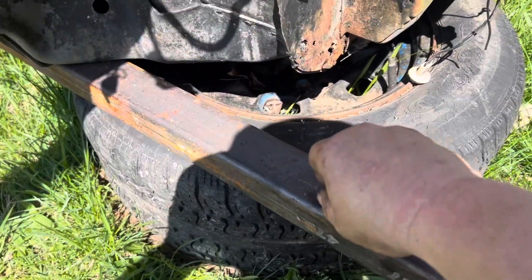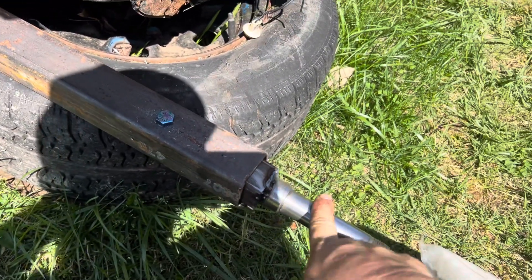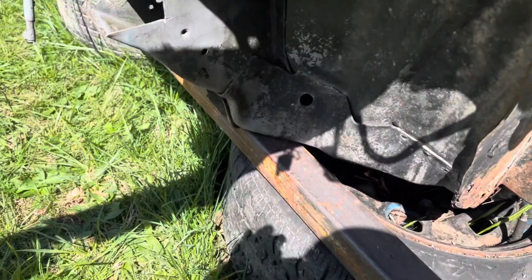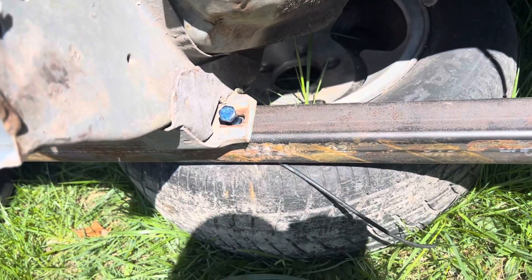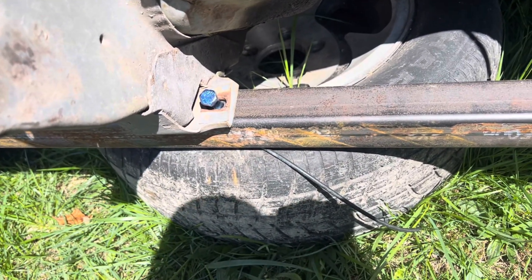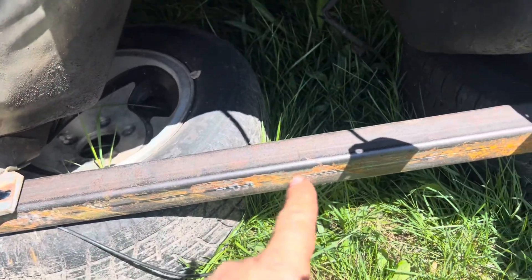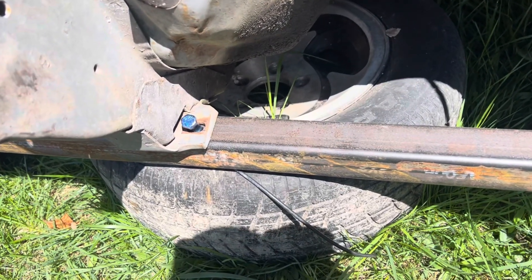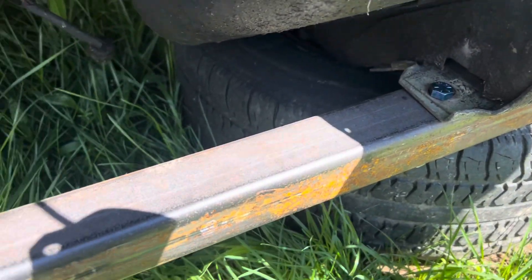So here's where we're at. I put these bolts — I drilled this, it's just in there so I can actually remove this, and it's honestly easier for transport, like if I go get something. I drilled this tubing for that, and I couldn't get a nut in there obviously because it's sitting on tire. Those are 28 inches apart, center to center — 14 inches each side. I drilled half-inch holes and I'm using 7/16ths bolts. Honestly I could stand to have some washers on them.